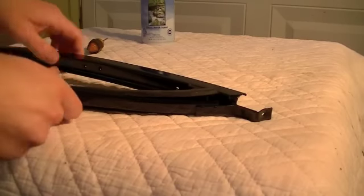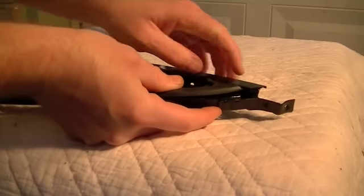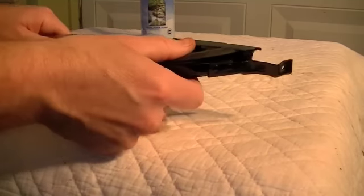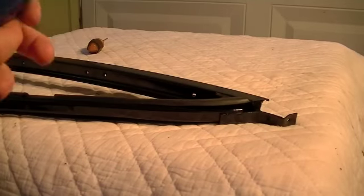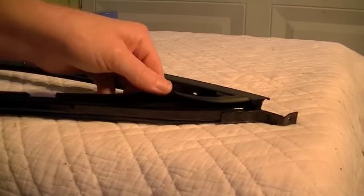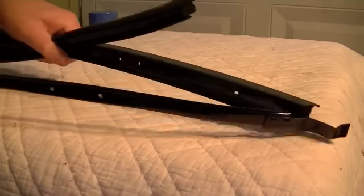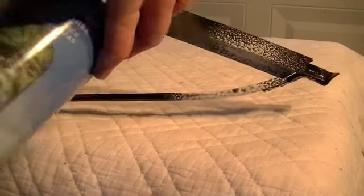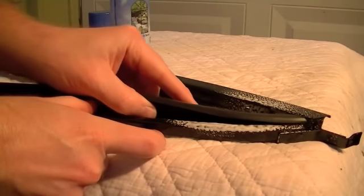Alright, so let's go ahead and get started. I like to start here up at the top and get my weather stripping wedged in up here at the top. Now you're going to need a lot of patience for this. This is a time-consuming job to get this done right. So I'm going to use a little bit of glass cleaner, just as a lubricant. You can use glass cleaner, you can use soapy water. I would not use any WD-40 or any sort of rust penetrant or liquid wrench or anything like that. It'll leave a residue. This, when it dries, won't leave a residue. So just give it a quick spray, and we can start sliding our channel, getting it wedged up in there where it needs to be.